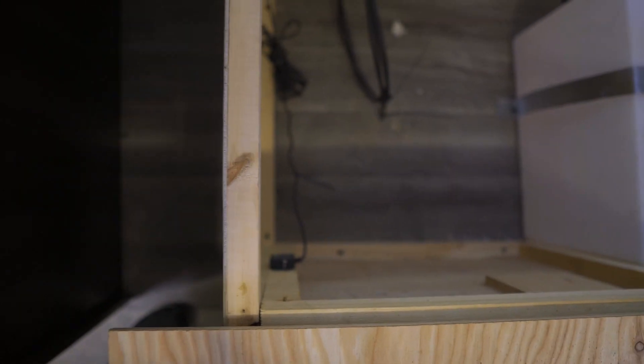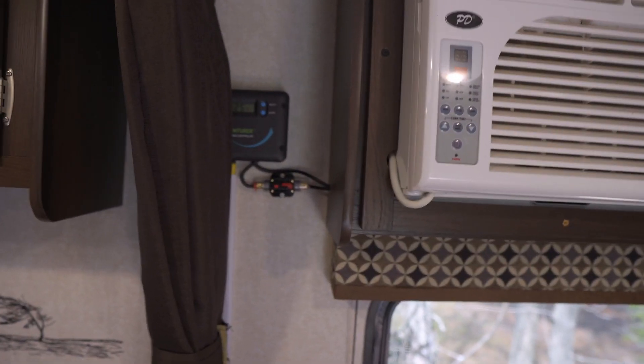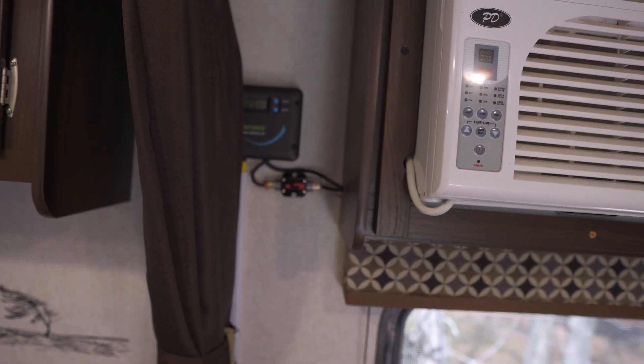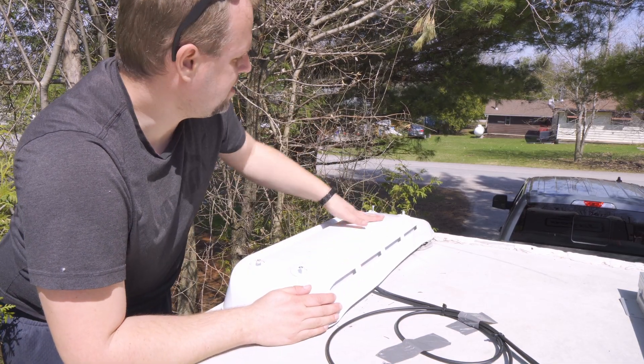We have the breaker between the solar panel and the charger, and down here we have the breaker between the battery and the solar charger. I curled up the wires through the hole and added a little spray foam to seal it. The Bluetooth controller is installed over there. With the curtain in its normal position it's a pretty clean install — you can see the breakers, but I wanted them accessible.